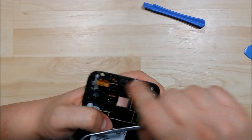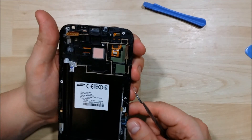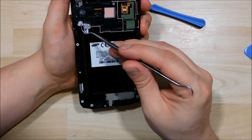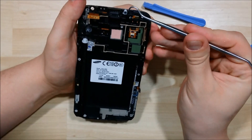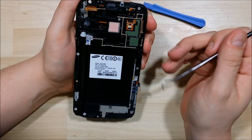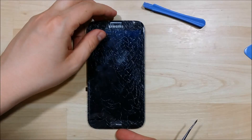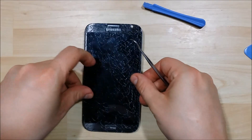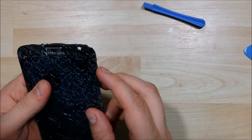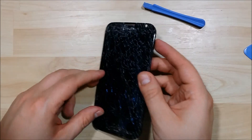We are looking nice and disassembled on this Note 2. Go ahead and click the link below and that will show you how to remove the glass off the front of this Note 2. We'll be doing a full LOCA repair on this — using some liquid optical clear adhesive and a UV light to re-glue the LCD back onto glass. If you're just replacing the frame or the LCD with a brand new frame, you can still follow this tutorial; we'll just skip the LOCA adhesive. Thanks for watching the video.